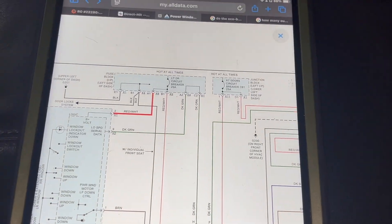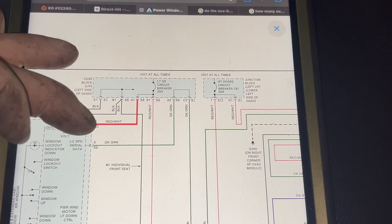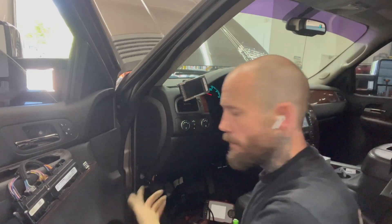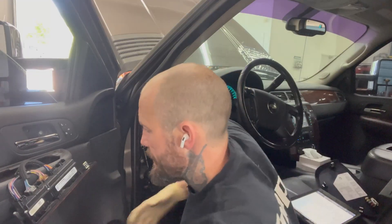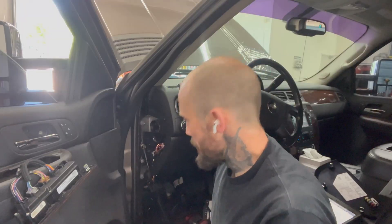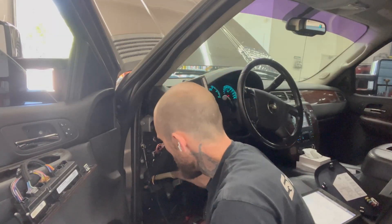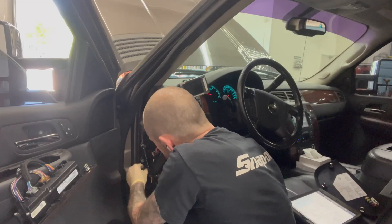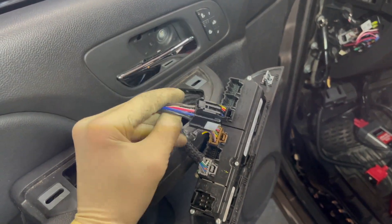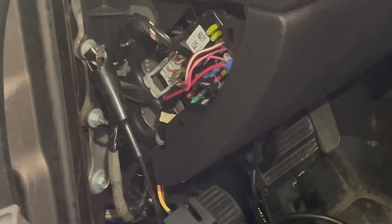Come back to our trusty wiring diagram. We can see there's no power here, and it doesn't show pin 4 on here — but we know we do have power there. So come over here, look — boop, boop. There's a panel on the left side. I think I can find that. There's a panel right here, go ahead and pop it off. You've got to find out which of these red and white wires is not having power on it. The simplest thing you can do is pop off some of the stuff down here, grab the harness coming through the door, and see where it goes. Follow it around — and there it is right there.